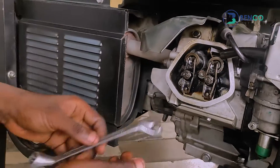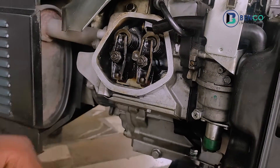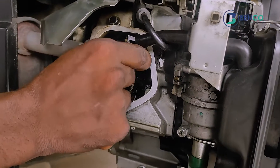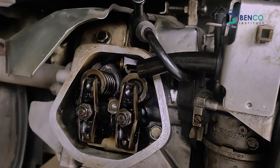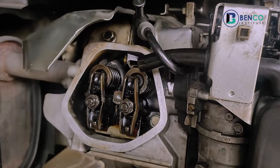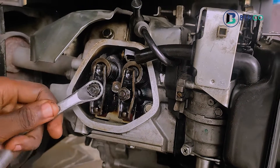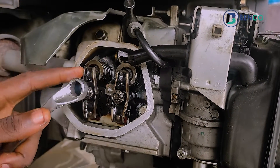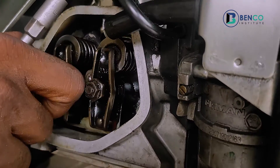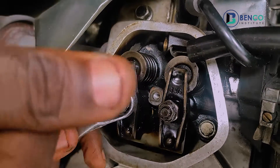I have my 14 spanner here. You can decide to use a flat spanner if you want to, but I usually use this one and a three-way spanner. What I do basically is to close the valve. This valve is very much open, and it's open because I need my generator cord to be free so I can start it easily. I'm going to close this valve. I'm loosening it out, then taking it down a little, and then I tighten it.